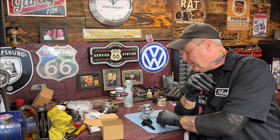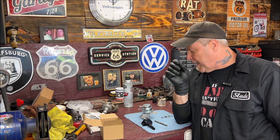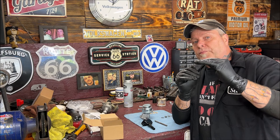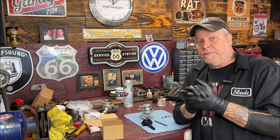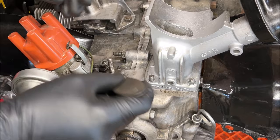If you are switching over from a generator to an alternator, do not mix these up. If you use a generator rod in an alternator fuel pump, the rod is going to be too long and something is going to break. Now let's go over to the block. Remember to keep a rag over that hole when you're working around it so you don't drop anything down inside.